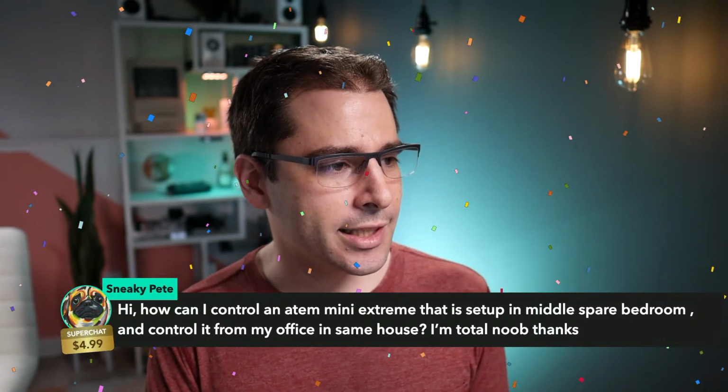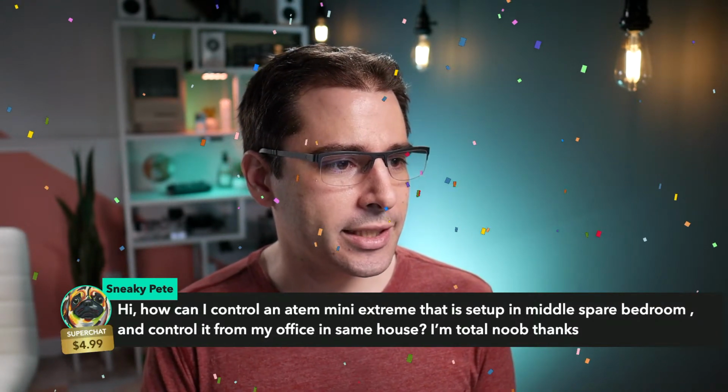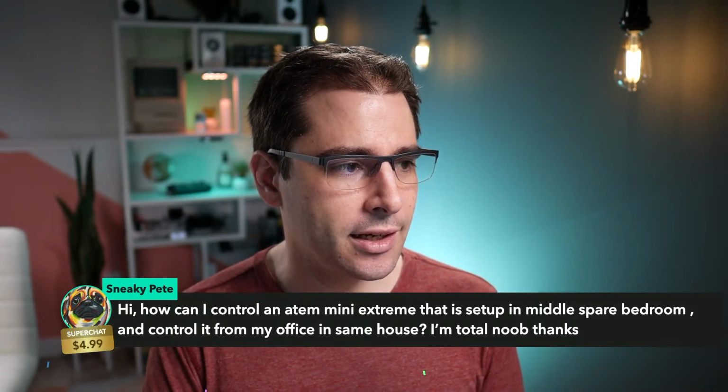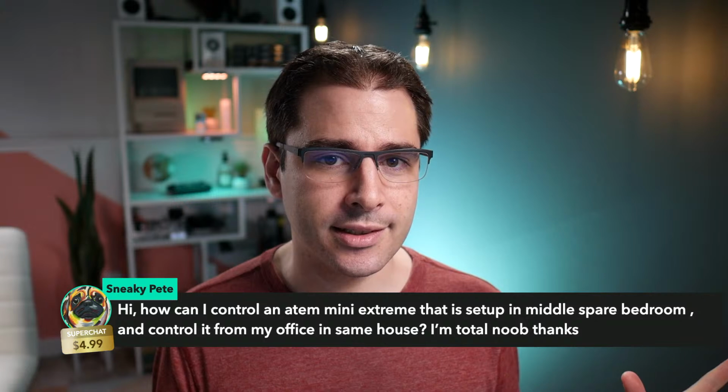Oh, Sneaky Pete, thanks for the super chat. How can I control an ATEM Mini Extreme that is set up in a spare bedroom from the office in the same house? Networking is your friend. That is the answer. The ATEM is wired networking only, so you'll need to run a wire to something. You could hop it onto your wireless if you do some fancy router tricks, but the easiest way is just to run a network cable to your office, and then it'll be on your network. Once you plug it into your router, it just shows up in the software control on your computer.